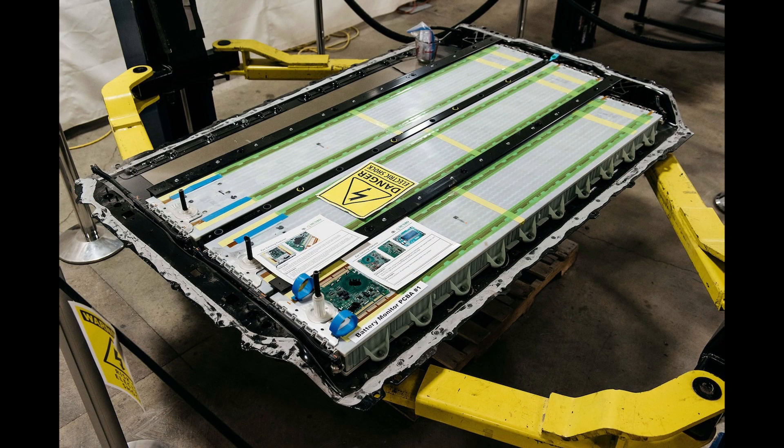The first thing I want to talk about is the battery pack size. If you look at the Model 3 battery pack — which is what I'm comparing the pack to that was presented at Battery Day — the entire battery pack has dimensions of 216 cm by 147 cm by about 10.5 cm high. That includes several strengthening beams and side support structures to give the battery its rigidity, which will not be the case for the new battery. If you take away all those structural things and just stick with the battery modules, then we have four modules, each about 29.2 cm wide and 185.4 cm long for the longest modules.